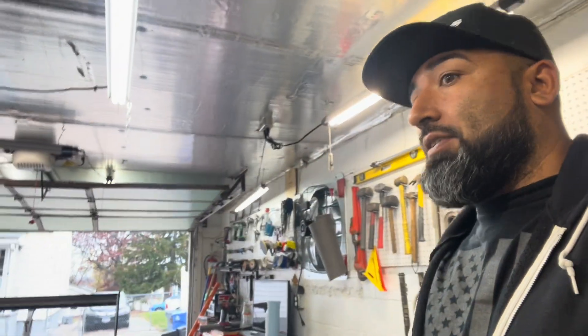There are some spots where I could probably squeegee afterwards and get a little resin off, but I'm not even going to sand this — just leaving it like this. For the hinges, I took the factory hinge, welded about two inches onto it, epoxied it down, and then put the carbon over it when I did all the rest of this. Right now these hinges don't sit flush, so I'm probably going to tape around the edge and put epoxy underneath to get a good bond so it won't be as flexible.